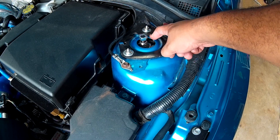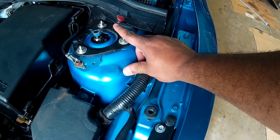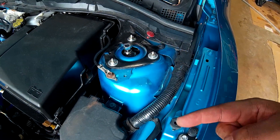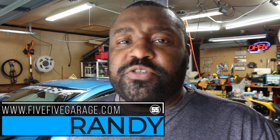In order to do that, I'm going to first have to jack the car up and get it on jack stands. I'm going to see if I can get to my front end links by just turning the wheels instead of taking them off. After an unscheduled wardrobe change, I'm back. The front is jacked up in the air. I'm going to leave the front wheels on, turn them, disconnect the front end link, then come up top and unbolt the top of the coilover from the strut tower, giving me plenty of space to use the hole saw without hitting anything. I'll do both sides and then put the new adjustable end links on before lowering the car.